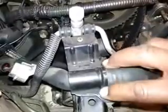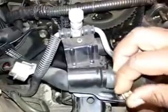A lot of people are saying you've got to disconnect your AC, and you do not. You take that one little bolt out. There's nothing under here — it looks like there is, but there's nothing under here. If your car has AC, you just lift this up and that belt will come right through here. It's clear all the way across.